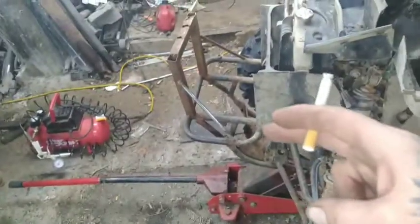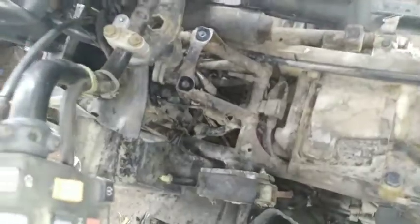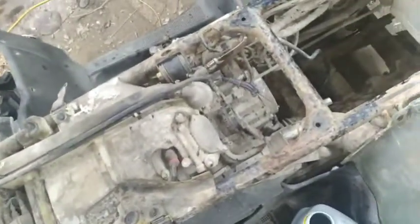In the meantime, we can redo the front push bar and everything. We've got the tank off, we can clean that — it's on the truck. We'll get this area blown out of all the debris. Now we can get the choke, get that unbolted and pulled out, slide the new choke in. Let's get the new cable in so we can sit the carb in.